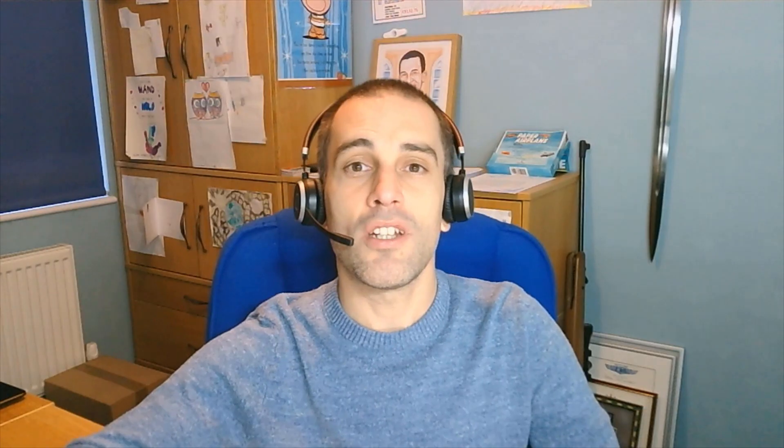Now you've got the motor in place, adapted to the gearbox, powering the rear wheels. To make your car go, you're going to need batteries. Any lithium-ion battery technology runs at about four volts per cell, and you put them in series to increase voltage to what your motor and controller need — the same as in a Tesla or Nissan Leaf. Trust me, storing the batteries will be the biggest job of building your EV car. Batteries are big, heavy, need containment, and are dangerous at high voltages. Plan ahead and make sure you have enough space.